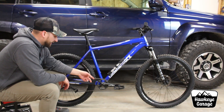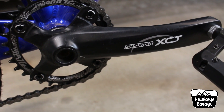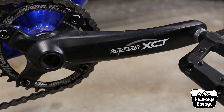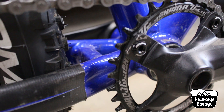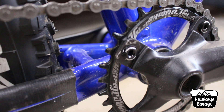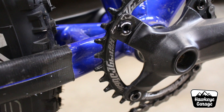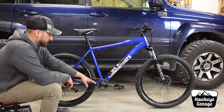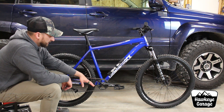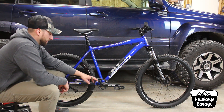Down on the cranks, I left the cranks the same and just changed the three sprockets down to a single sprocket. This is a narrow-wide chainring, meaning every other tooth is either narrow or wide, which helps keep the chain on better. It's also an oval chainring — just slightly ovalled — and that actually helps with the physics of your pedal stroke to more evenly apply torque to the drivetrain depending on where you are in the pedal stroke.